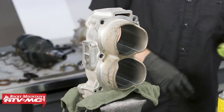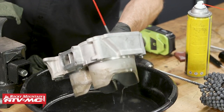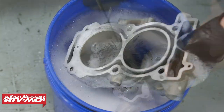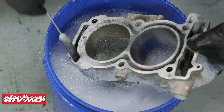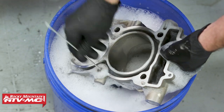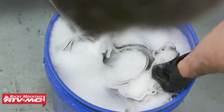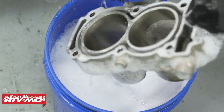Now that we've run the hone through both cylinders, we'll remove it from the vise. We're going to spray all this oil down into our drain pan, and then once all the oil is removed, we're going to use some soapy water and our brush to finish cleaning these bores out. We're also going to run a brush through the rest of the holes, including this oil passageway. The reason we're cleaning these cylinders out so well is any material that's left in here will destroy any work we're doing now. Once we've washed it out really good, we're just going to rinse it off with regular water, then dry it off and apply some light oil to the cylinders.